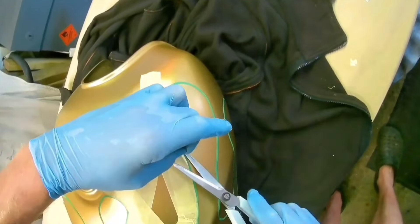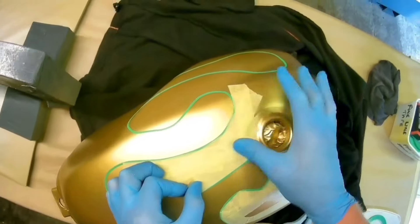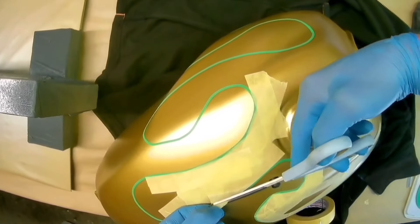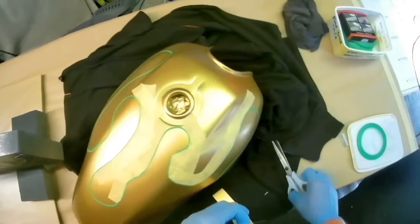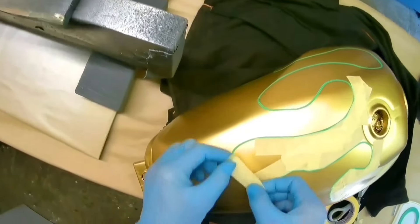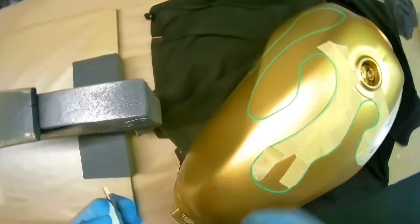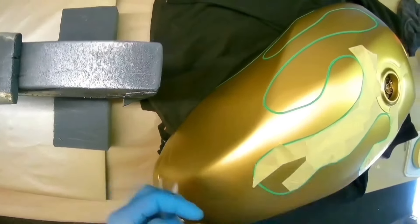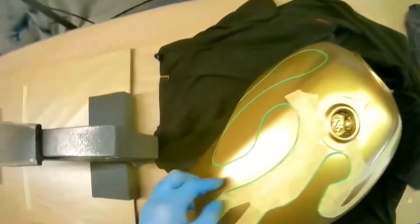I don't get much problem with bleeding when I use fine line tape, as long as you do your coats properly, keep your finger off the tape before you lay it, and use a good quality tape. This is J Tape, which is an English make but I believe it's available throughout much of the world — the Americas, Australasia. A lot of people reckon it's better than 3M, although some say 3M is better. It's a personal choice, but I find it really good. I'm not sponsored — I pay for it.